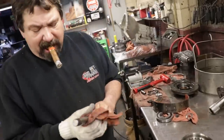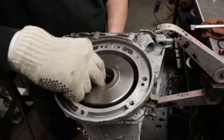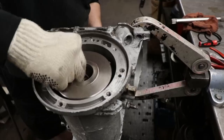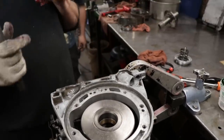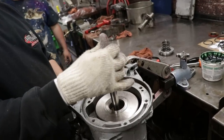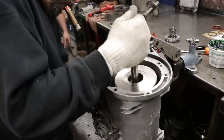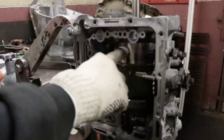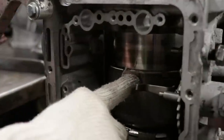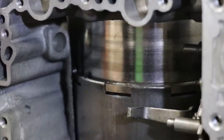So now we'll put that front drum in. Same deal. You got to get it started, turn it, lock all your clutches in. Now once you get it to the bottom, you're trying to turn everything. So what I'll do is I'll put the input shaft in so I can turn the second drum, the rear drum, and it'll help me drop in. You'll see this front drum has these tabs that lock into this sun gear. So when it's down all the way, you know all your friction are engaged in that hub on the front planet.